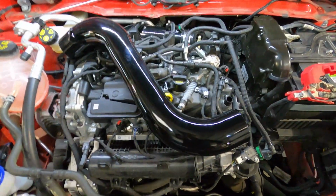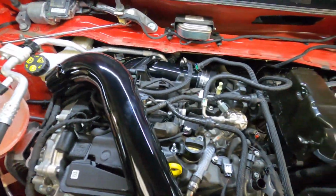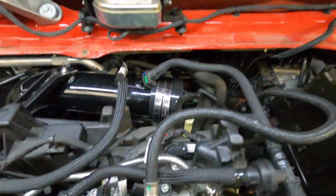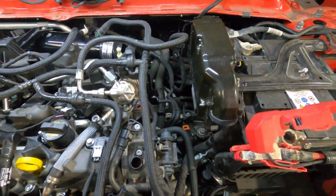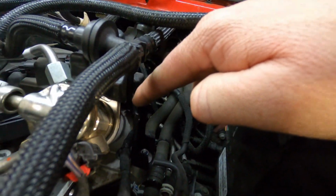Next step, we move to the side of the engine. Now down here you will see a lone stud by itself. At this point, we fit the alloy spacer. Next we fit the longer pipe. This again passes through a very tight space, so please be careful not to damage the pipe. This outlet goes at the top and will connect to this pipe. We'll then pass through, keeping a close eye on this and this, because these are very close to touching. Then we will mount the pipe with the welded in union there to this bracket.